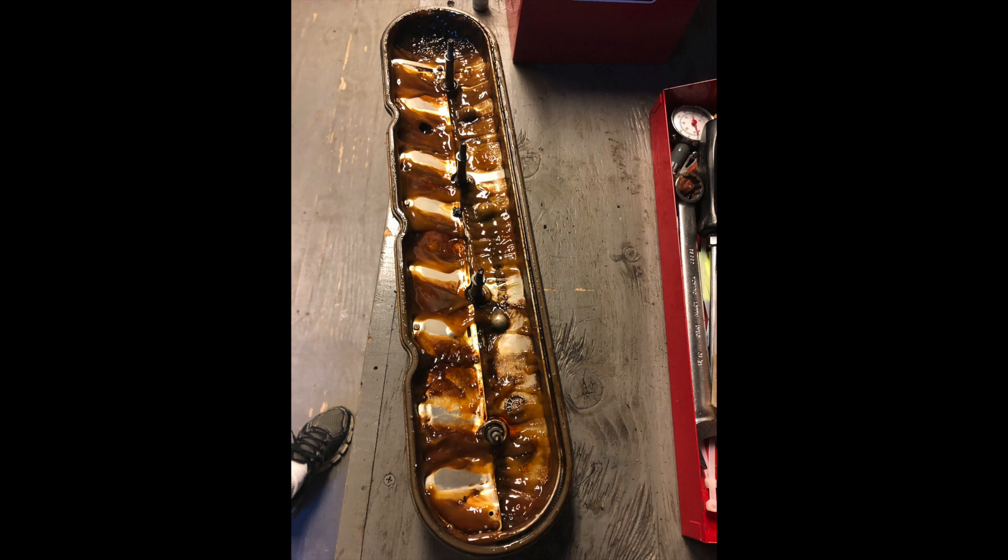Sounding like a diesel truck and looking like a diesel truck with the blue smoke chooching out the tailpipe. A couple other things you can check to verify the cracked head: obviously your coolant level will be going down with no visible signs of any leak on the motor. You can also check the oil fill cap after you shut your truck off — just open up that, have a look in there and you'll probably notice some steam and vapor coming out of the top of the valve cover. Those couple things combined with the evidence from this video, you're going to be pretty certain that you have a cracked head.